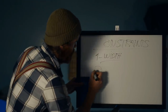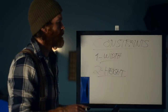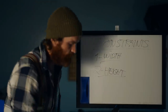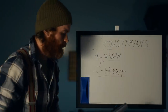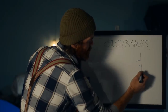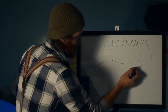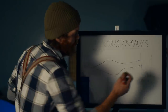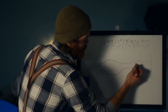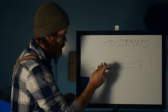Constraint number two: height. In your pursuit of area, you can only go so high before you start destroying the resonance in the pipe. I'll talk more about resonance in the pipe later, but for now it's about the port. Imagine this being the cylinder, that's the exhaust port, and this is the pipe. As the piston travels down and cracks that port open, a pressure wave will start travelling in the pipe.